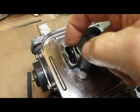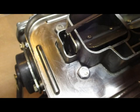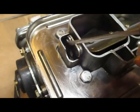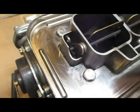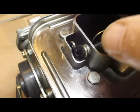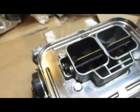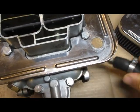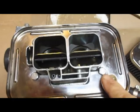There's a little snap clip for this linkage that has to come off — it's a C snap ring type thing. It goes on here and freeing it lets you lift the top off. I didn't have mine on this one because I borrowed it for another carburetor. You also need to unscrew this and remove the four 10-millimeter bolts.